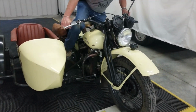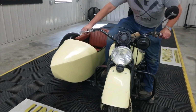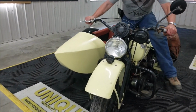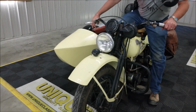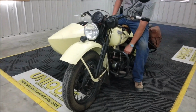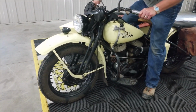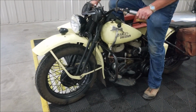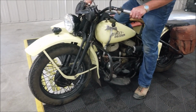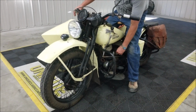There is an advancement of timing and what have you on the left handlebar. I'm going to redo it. I'm going to go from a cold start. We thought it may fire off the first time. We're going to go back to just like it's a cold start, which you prime it with the key off, turn it over a few times, 3 times it is, and then we'll go ahead and turn the key back on and away you go.